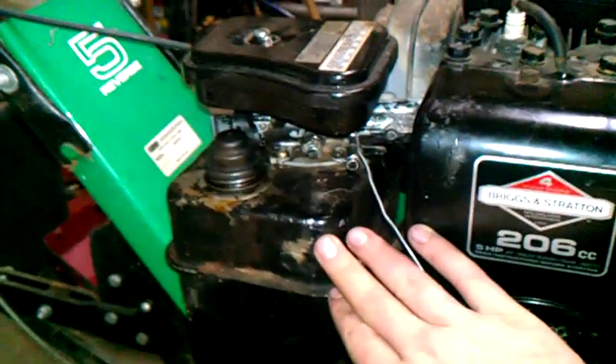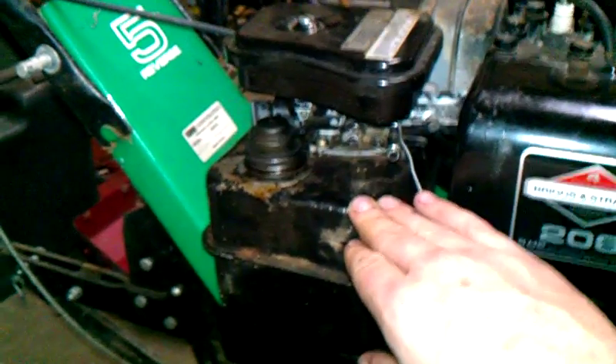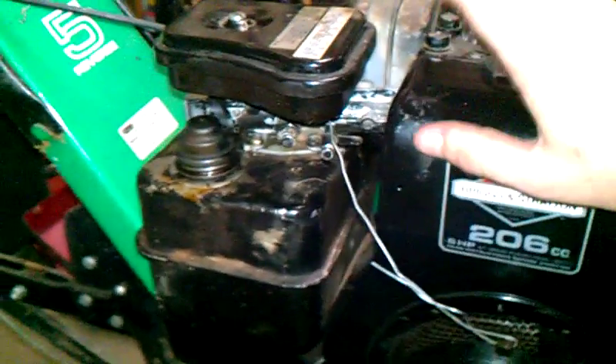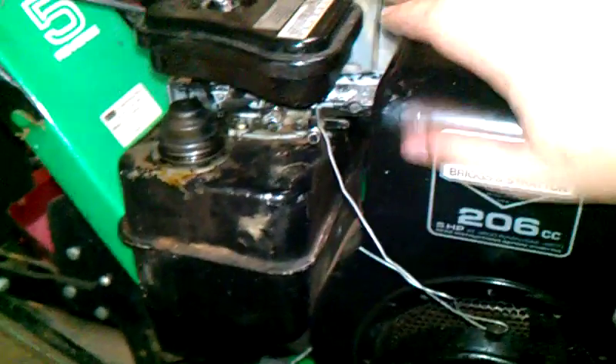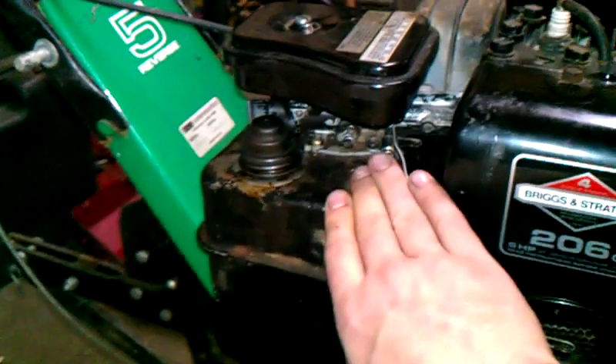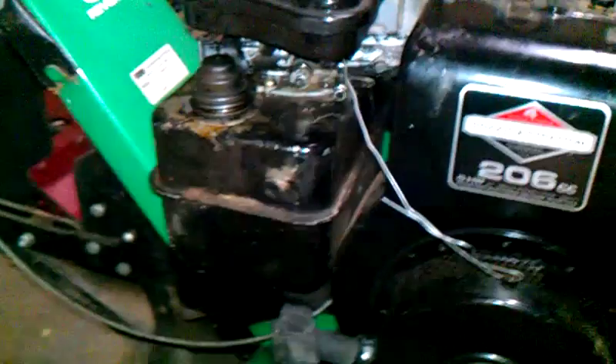The way I did this: I dumped out all the residual nastiness that was in there, put a cup of gas in it, and grabbed a handful of pea gravel. A lot of people are going to give me flack about this, because you're not supposed to do that — but it works, trust me. The thing runs; I'll show you a video proving it. It starts on pull. I threw a handful of pea gravel in with a cup of gas, shook it out, and had to do that like four times. Before it looked like it had about that much dirt on the bottom; now you can actually see metal on the bottom of the tank.